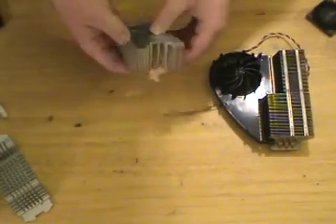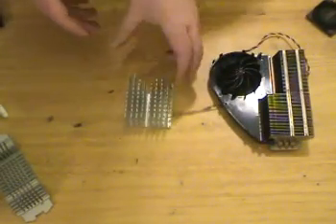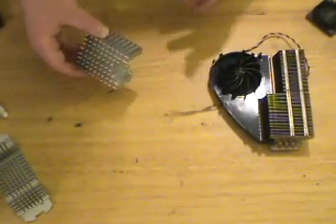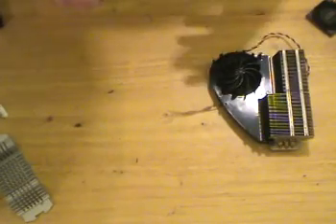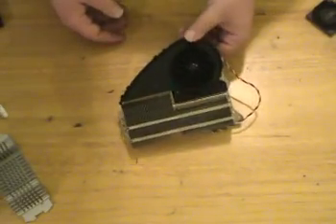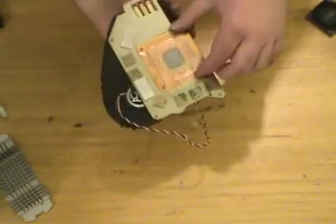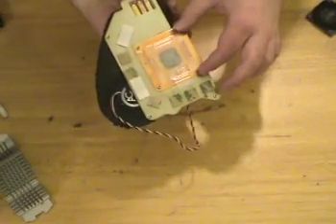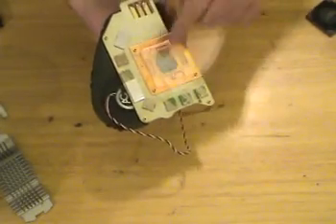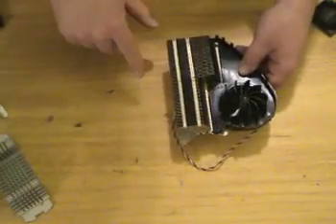Right here is an example of just a cheap heat sink, but it's got a whole lot of surface area. The more surface area, the better the increased cooling you're going to have. But remember, you always have to have airflow across it to increase cooling to a normal level for modern CPUs. What I have here is an aftermarket GPU cooler that uses heat pipes, which run along and are connected to each one of these fins, connected on the back to a copper plate that touches against the GPU using Arctic Silver thermal paste. The heat from the pipes dissipates down each pipe equally and then gets cooled by the fins.